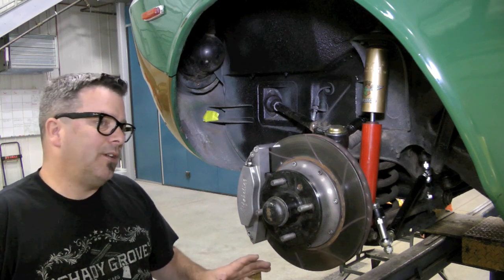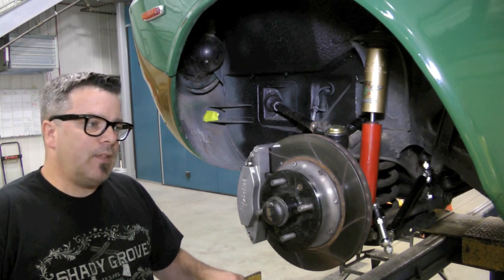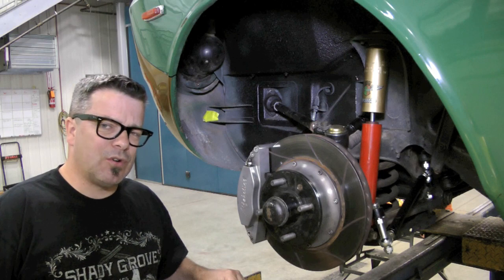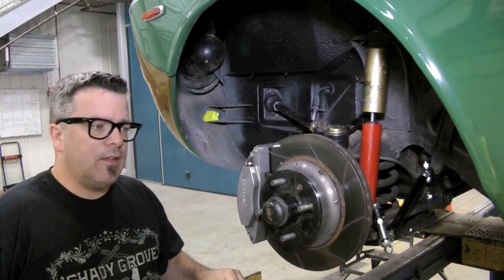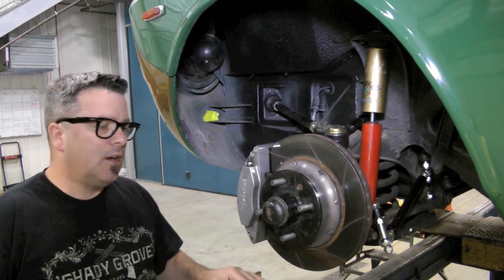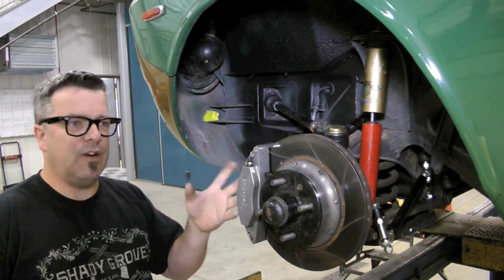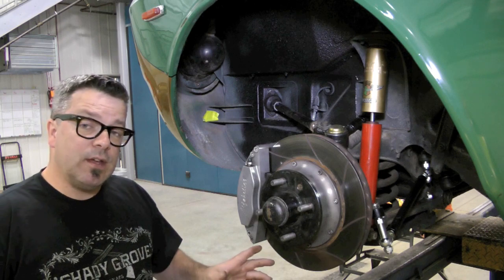Full dress race cars, depending on setup and what wheels and tires are on them, can range anywhere from zero to maybe even three degrees of negative camber - that's pretty strong. Most cars, especially with the Alphaholics geo kit, would run one, one and a quarter, or one and a half degrees - that's about as much as you would go. On all the race cars we've prepped with this product, we found that 1.25 to 1.5 is about max. But let's go ahead and get started.